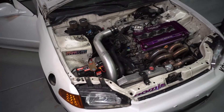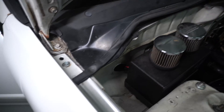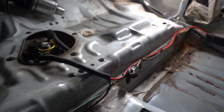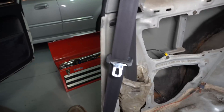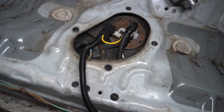It is completely wired up — I'll show you how I have it set up. The smaller red wire goes to the positive terminal, with the one closest going to the fuel pump, nicely zip-tied along my other power wire. It runs underneath the breather box and into the cabin, under the dash across to the driver's side, snakes over the pedals, and I fed it through the factory wire sheathing. Everything is zip-tied up back here, with the red wire going into the loom and to the relay, grounded near the seat belt mechanism inside the panel.